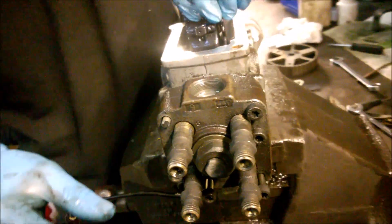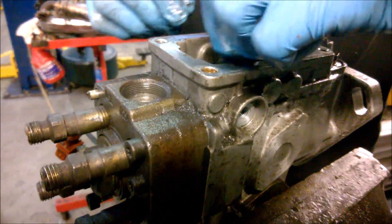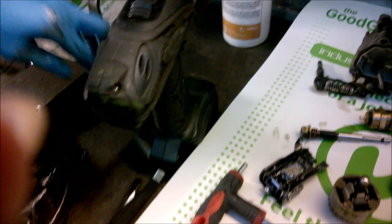That will allow you to pull out your lever assembly. The easier and safer way to do it is to actually loosen the head off a little bit — that allows a bit more movement and it'll come out a lot easier, because at the moment the return springs are pushing against it. I was in a hurry which is why I've done it like that. Loosen the head first, because if you don't it will break. You won't be as lucky as me.